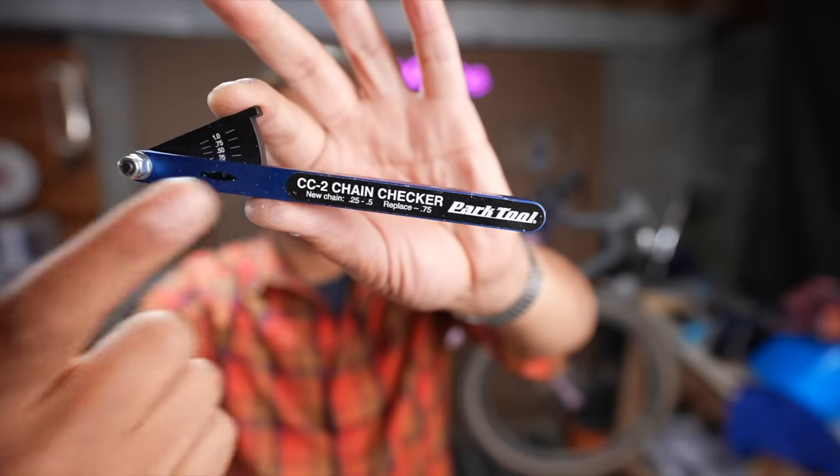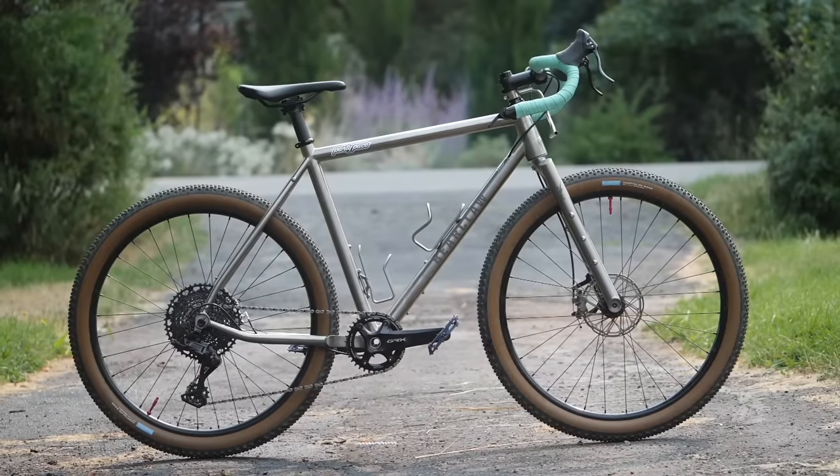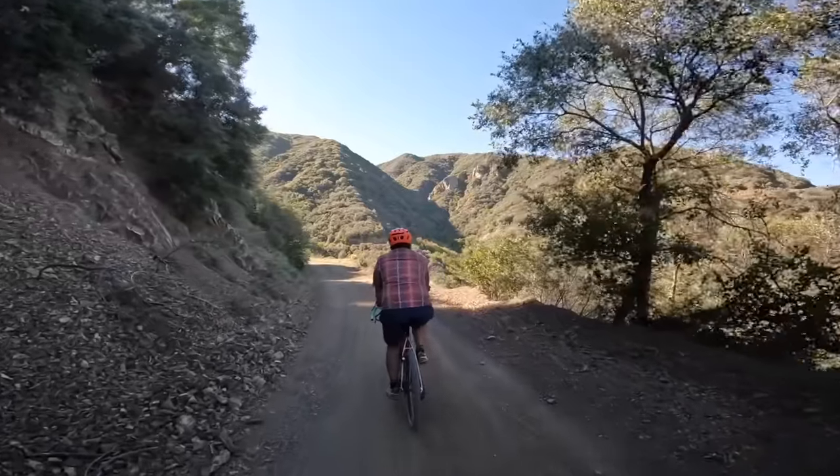On all my personal bikes I've changed to a wax chain system. I recently checked with the Park Tool chain checker and all the chains are in pretty good condition — the most worn chains are still between 0.25 and 0.5% wear. For reference, you're supposed to change your chain at the 0.75 mark, so there's still plenty of life left. The most worn chains are Laura's Breadwinner, since that's the only bike she rides. The chain on my Bear Claw has seen the most use — I took it down to Southern California and Nebraska — and it's still wearing fairly new.